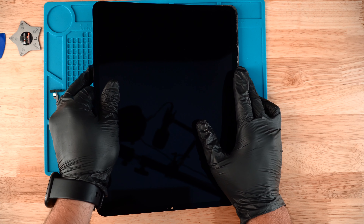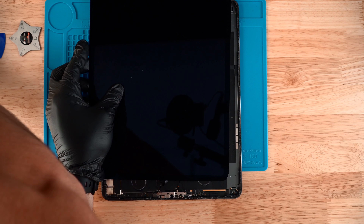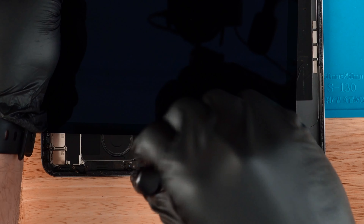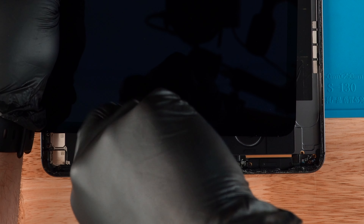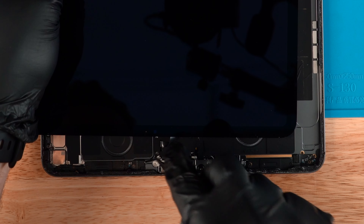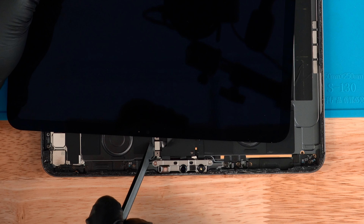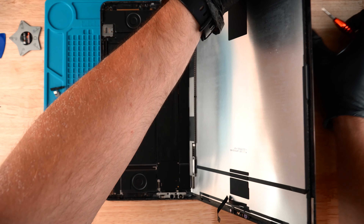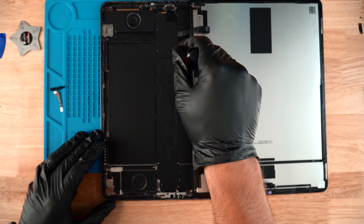Once we got to this point, peel the screen off. The iPad is upside down — pull the screen back to expose the face ID ribbon. We're going to use a 2.0 Phillips screwdriver to remove the two screws for the face ID cover. For this power button replacement we're actually going to remove the screen entirely — it'll be easier and we have to reapply adhesive. Use a plastic spudger to disconnect the face ID from the motherboard, then fold your screen in halfway and pop it open. Next, remove these five little screws.